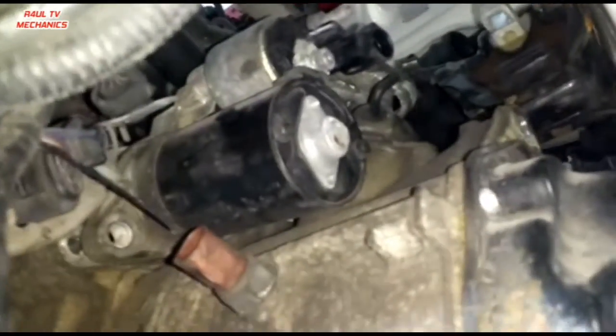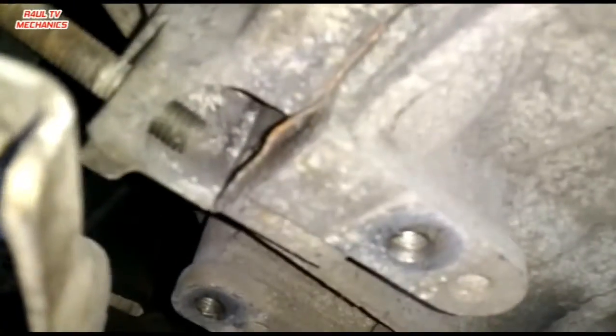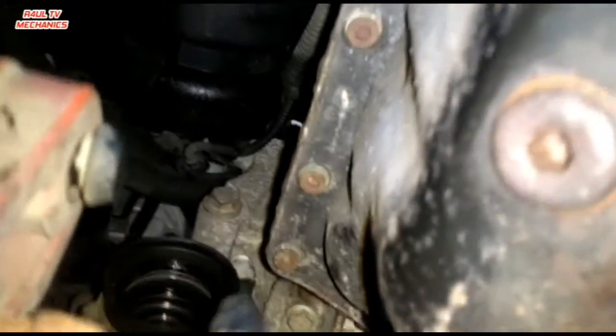All right, guys, sit rep. We've took the starter bolt off, the bottom one. It's not gonna come off, and you don't need it off unless you're changing the starter motor. It'll come off with the gearbox. All the bellhousing bolts are off, except for this one. That's gonna be our last bolt. One's down here, that's not coming off. It doesn't need to be off because it's separated from the gearbox. The one on the back is still on. That's gonna come off last.